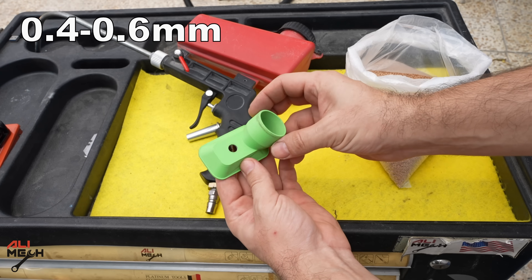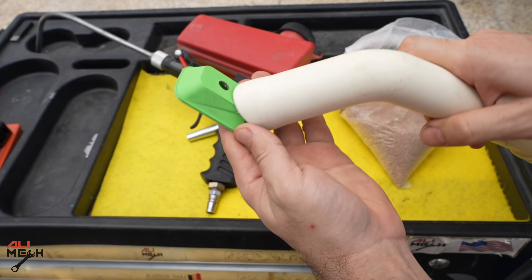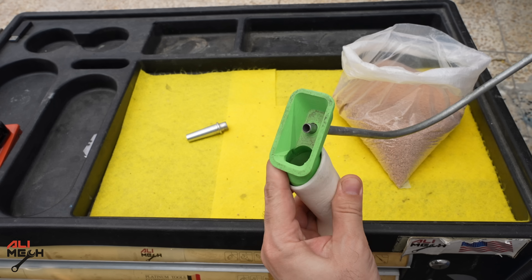To keep everything clean and not make a mess, I designed this adapter which will replace it on the valve port, suctioning all the walnut shell while we are blasting with the gun. If we don't have this, the valve port will fill up and the injected walnut shell won't hit the valve anymore and won't clean it.